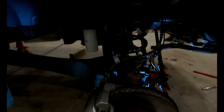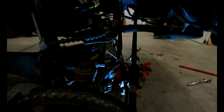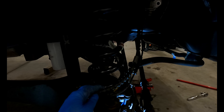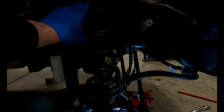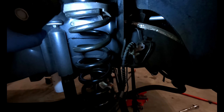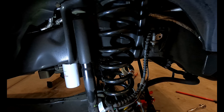We ended up taking both tires off and had to undo the sway bar ends so we could drop the axle lower — we got the other spring in. Everything was supported with the jack, but to avoid snagging or stretching any of those lines, we didn't remove the brackets. A little more work than I thought, but if you have a spring compression tool you probably wouldn't have to do that — these 7,000 pound springs are not moving without that tool. There's a stop that you want to make sure the spring is seated against, and this rubber stop has a specific orientation. Now we'll jack it back up and get everything bolted together.